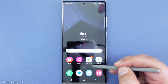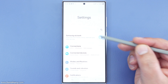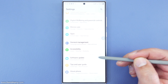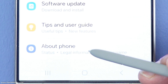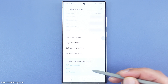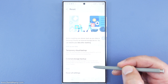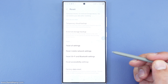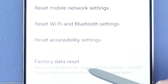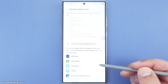So what I'm going to do here is scroll to Settings, so I'm going to tap on Settings now. From here we need to scroll all the way down to the bottom. Once we're at the bottom we need to click on About Phone, so I'm going to tap on there and then scroll to the bottom. Then we have Reset, so I'm going to tap on Reset. From here if we scroll down a bit more we've got a number of options, but it's the bottom option that we want which is Factory Data Reset, so I'm just going to tap on that.